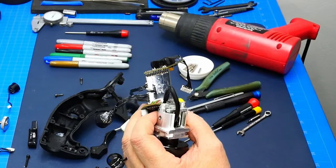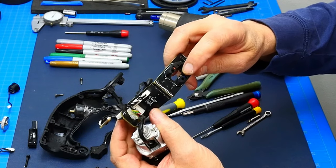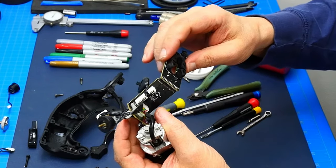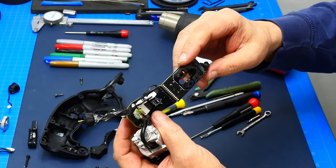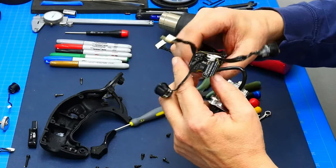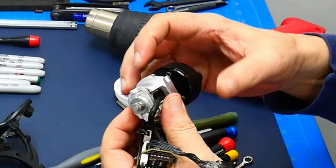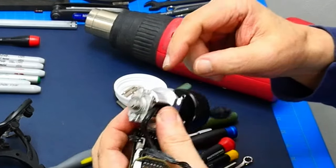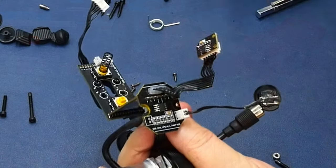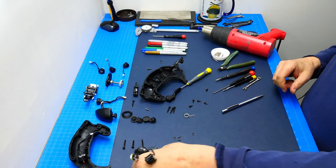It's a mouse wheel with a scroll wheel which goes in here. There are two tactile buttons here for obviously left-to-right movement for pushing. There's a button, a button, a button, the wheel, and a button. And here's our twist system, and here's the spring for it. There's the spring - nicely machined by the way - there's the spring, there's the magnet, and here is the hall sensor.